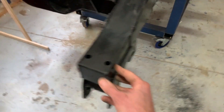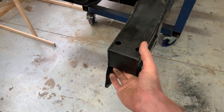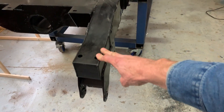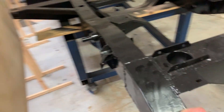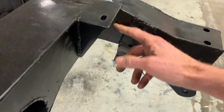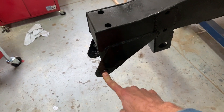And it's the same over here. So we replaced all the fronts here — they were all eaten out. Dirt and mud and water gets caught up in here, and it doesn't successfully drain once it gets clogged with mud. This is particularly important because it's holding the suspension, which means it's holding the wheels, and that's a key part of a car. You're able to buy these front sections and again cut the chassis and weld these sleeves over the top. What they don't come with, though, is where the steering dampener connects.